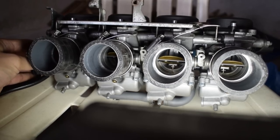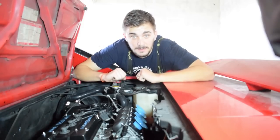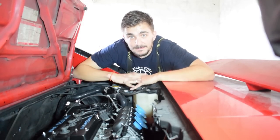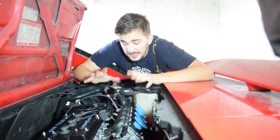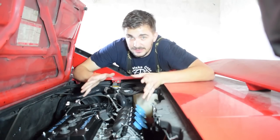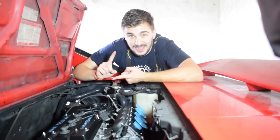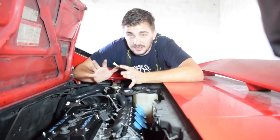You can probably see it best in this shot here. The throttle plates aren't in the same position, and I've done this on purpose so we have something to actually balance, because the carbs were pretty much balanced when they came from Dan at ST Engineering. Now, when it comes to balancing bike carbs on a car engine, you can run into some pretty unique challenges. Challenge number one can be access — especially if you have bike carbs on a front-wheel-drive, front-engine car. Access can be a nightmare in some cars.